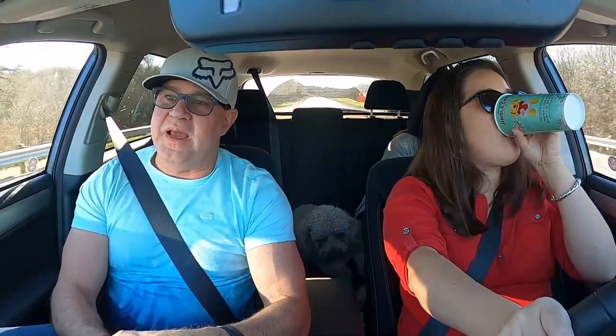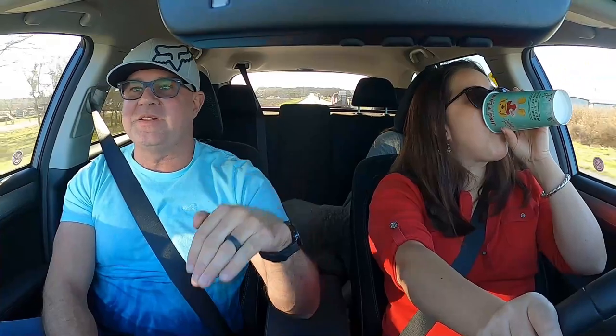The DRV LX455 is a 44-foot toy hauler — 24,000-pound GVWR. The DRV Nashville front living is also 24,000 pounds, still on our list. But 20% of 24,000 pounds is 4,800 pounds at the pin. You don't have any payload room left at that kind of rating once you add the hitch, your supplies in the truck, and a generator up front — which wasn't balanced at the factory and adds more weight to the front.